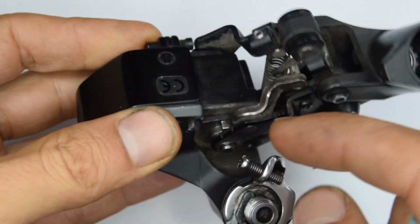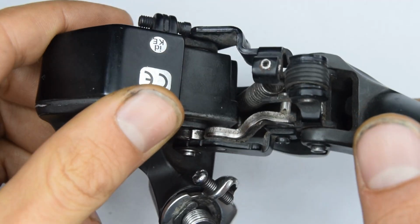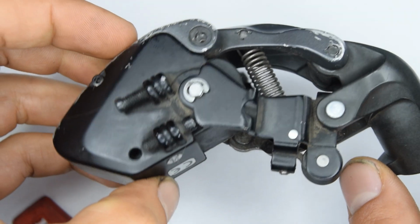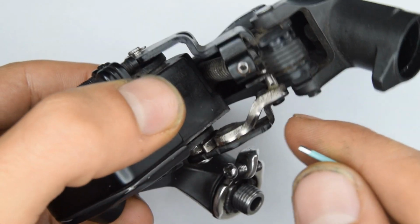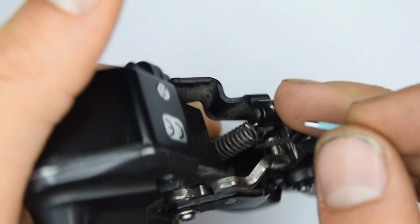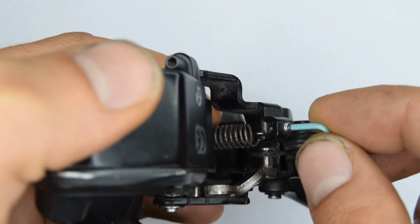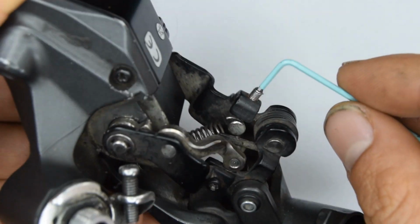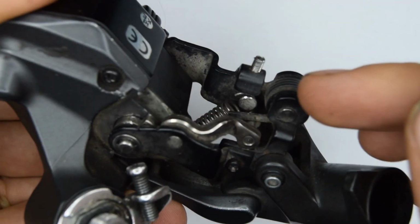So for the next process, we're going to be removing the motor. Now, I did have to do this once to kind of understand the procedure to access the main motor. So first thing we're going to do is I'm going to relieve a bit of that tension on this particular screw right here. This is a number 1.5, quite rare to use, and we're going to completely detension by lifting it up. We're not going to take it out, but just enough to relieve a bit there.